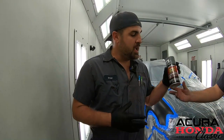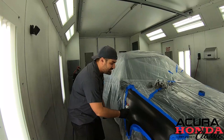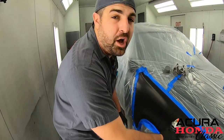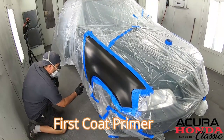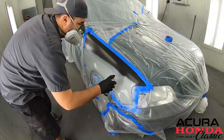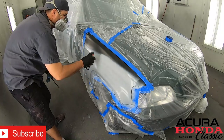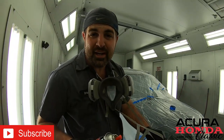Next up, we're going to put a filler primer on there. We're going to use Perfect Match by Dupli-Color — this is going to go ahead and fill in any fine sand scratches, and then we're going to smooth it off with some 600 grit. Make sure we're having about 75% overlap. When we spray, let's not stop right in the middle — let's do the whole length of the actual fender. That's going to keep it nice and wet and smooth. That's a very important tip. We've got the second coat about to go down and it's going to cover really well, so we're going to leave it at two coats for the primer.